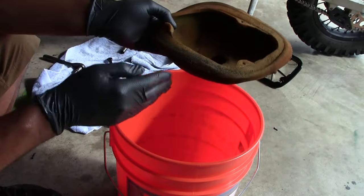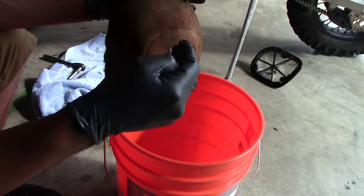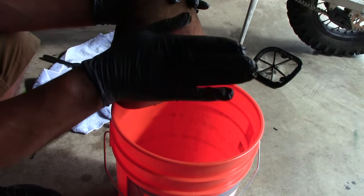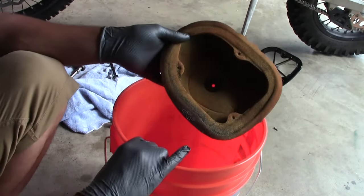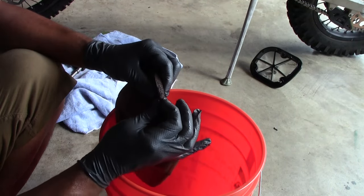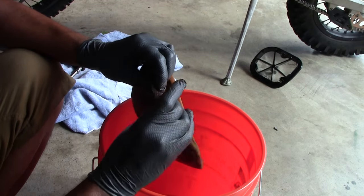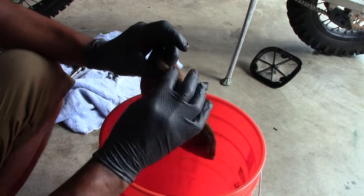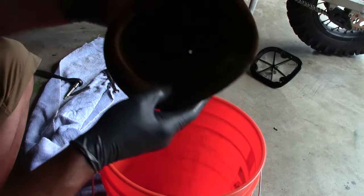I really tried to work everything from the inside out, because as the dirt travels into the filter it goes this way — we kind of want to push it back out the same way it came. The instructions say, before we spray it on, we're going to make sure we get any crusties off. So you can see here there's some crusted and greasy dirt — we're going to work that off. The grip on the gloves really helps without tearing the foam. It just kind of comes off like mud.